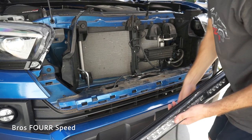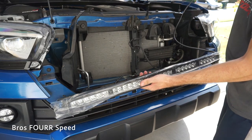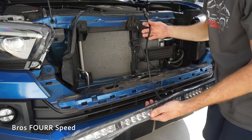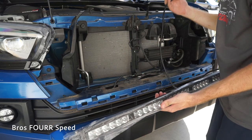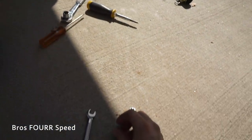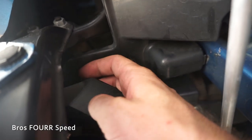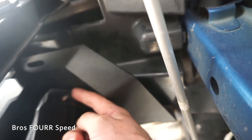So I'm placing the light bar now. I think what I'm going to do is take the side that has the wire and have that on the driver's side because the battery is right there. That way I may not need as much wiring as if I had it on the passenger side. Going from the driver's side seems to be the easiest way to do it. The hard part is going to be putting in both bolts on the side because I need to get in between the plastic and the back side here to go through the slot into the side of the light bar.